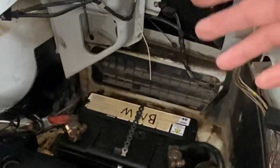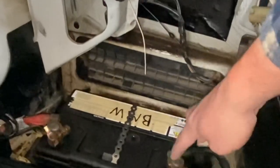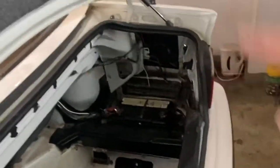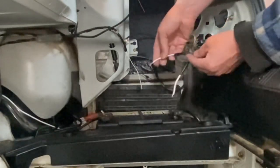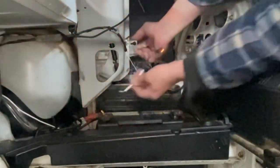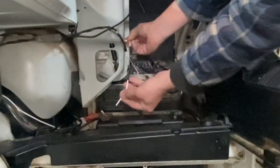Here's what most people don't know: on basically every car made, the negative wire hooks up to the body of the car — so the whole car is negative, they call it a ground. You have positive wires running to things. So if you hook a light bulb to the positive wire and touch the other end to any bare metal on the car body, it lights up — because the whole car is negative. So you've got negative everywhere and positive going to devices.